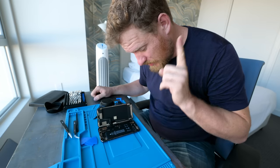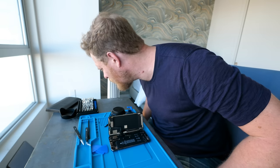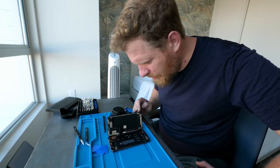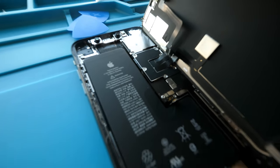The next step is always to unplug the battery. I heard there are actually two battery connections, so I'm gonna go after both. Next, I want to remove the screen and get rid of that right there. That big cluster of cables there — it's super easy to rip in all iPhones. Screen is off successfully.